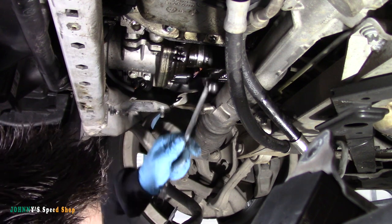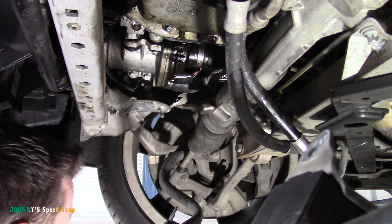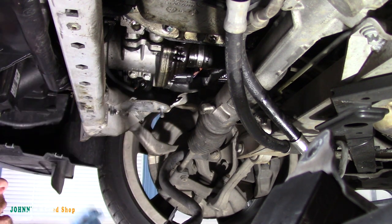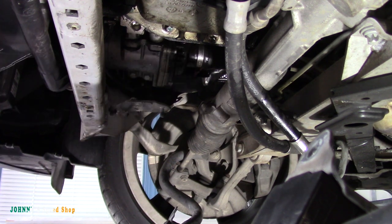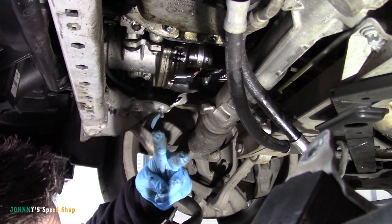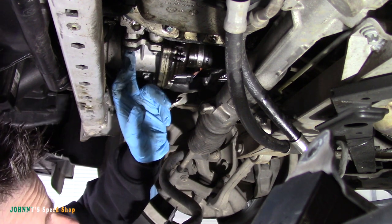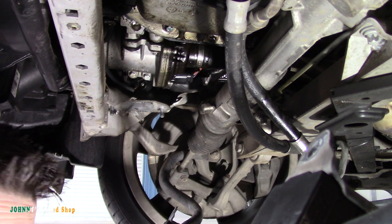Here's our pump, here's our main hose — thermostat's over here. It looks like the thermostat is screwed to the pump. I'm not replacing the thermostat. We're going to have to take these two tangs out. This hose, this connector — the thermostat connector we can leave — and then E-torx, E-torx. There's two hoses: one coming out here and one up top. So two hoses, one connector, two tangs, and three or four E-torx bolts. There's going to be another E-torx up there somewhere — we'll get that guy first because it's going to suck.